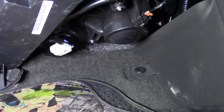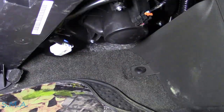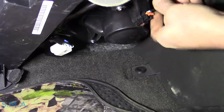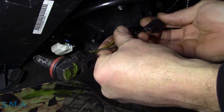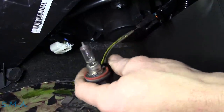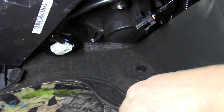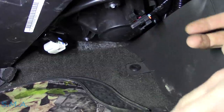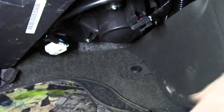Let's see if the blower works. You know what, mother lovers — you know why that burned up? I think this blower motor is junk. We don't want this one to go nuclear. Let's unplug this thing again. Let's make sure our resistor is still good — that should have just kicked that blower motor on. But I think she's lacking on us. All right, that baby resistor is still good. Blower motor is junk. She's junk — I just heard it go cha-chunk. I just want to make sure we're not burning up our new resistor.